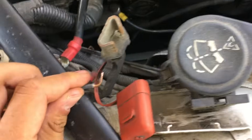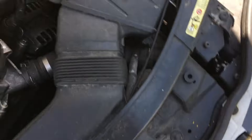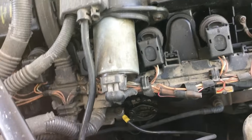This will tell you if the starter is good. It won't start because the fuel pump is unplugged, but if your starter is good this will tell you. Make sure it's in neutral. Touch this wire to the positive B post here — that tells me we have a good starter.